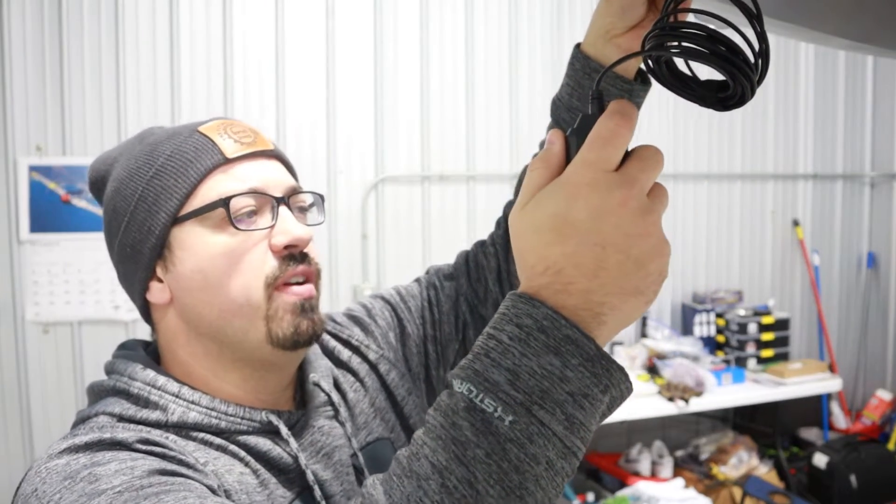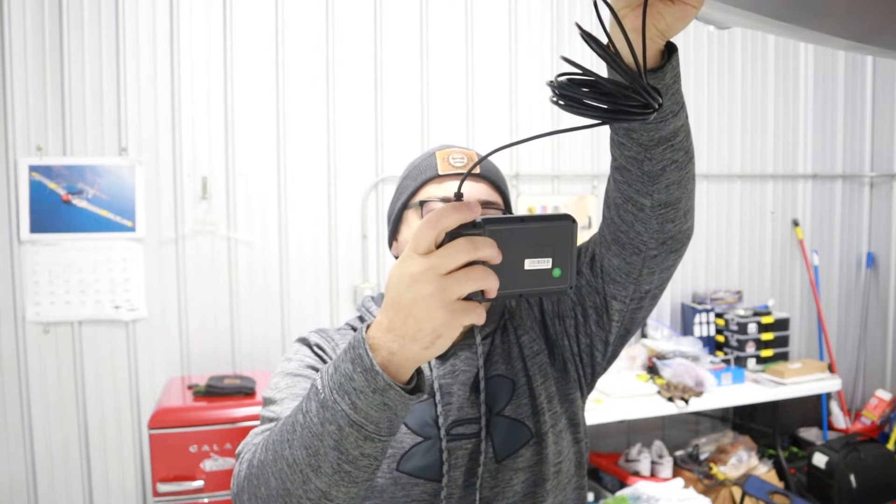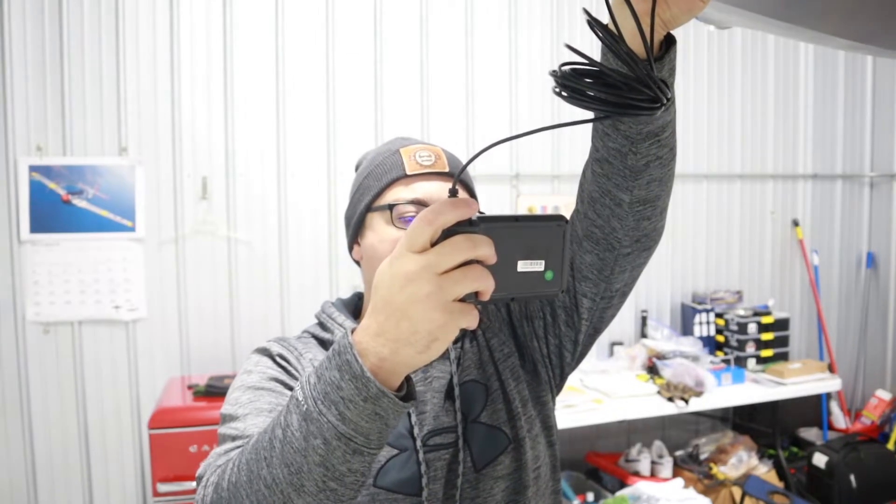You may be thinking, what's the purpose of even having that cheap borescope? Let's say you're flying for the first time in a few months — you've got a grass strip. For $50, you can just pop out an inspection port and very easily verify there's no rat's nest, no bird's nest. It makes an incredible inspection tool inside your inspection ports after prolonged inactivity. I do this on a regular basis outside of my annuals to verify there's no rat's nest in my 140 — if you guys remember, I ran into that situation where it had become what I call Ratsylvania Hotel. It's nice not just for engine inspections, but also for an owner doing a more thorough than normal pre-flight inspection.